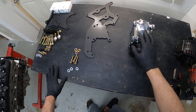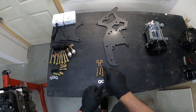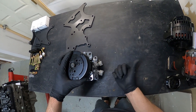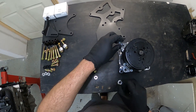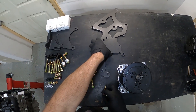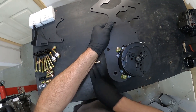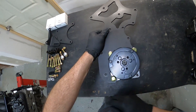We're going to go ahead and get our compressor mounted to the front plate. It's going to be mounted with three 3/16 spacers, three bolts and nuts that are included in the kit. You're going to want to install this with the ports facing to the right — this will be facing the frame rail in the car. Three spacers go on the pump in this location. The front plate goes onto the AC compressor with the spacers between the back of the front plate and the compressor.